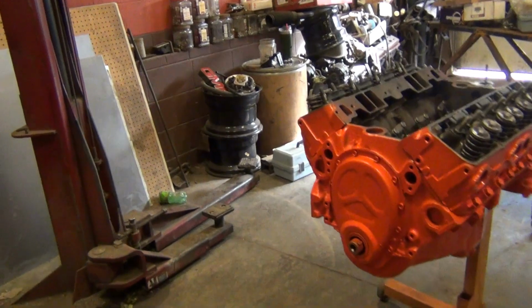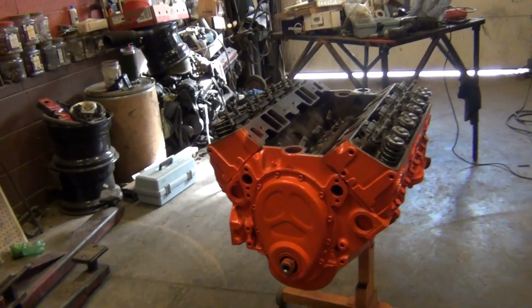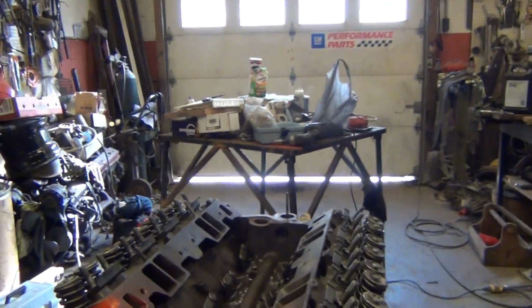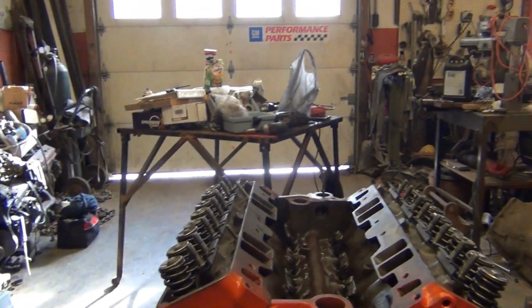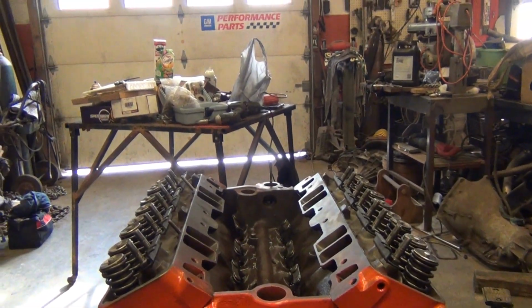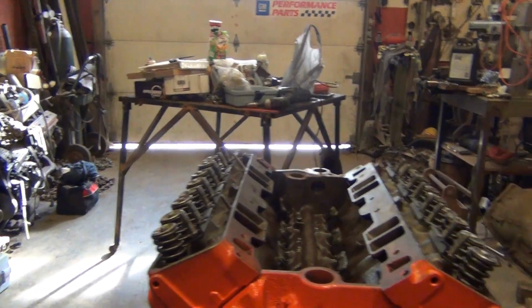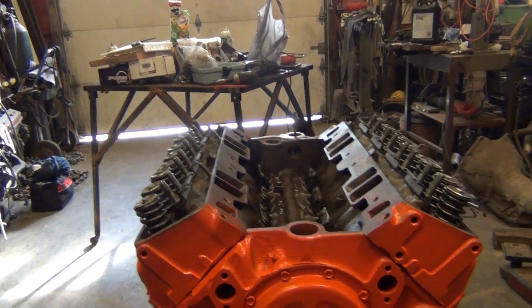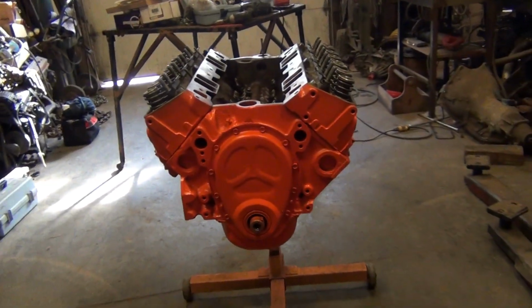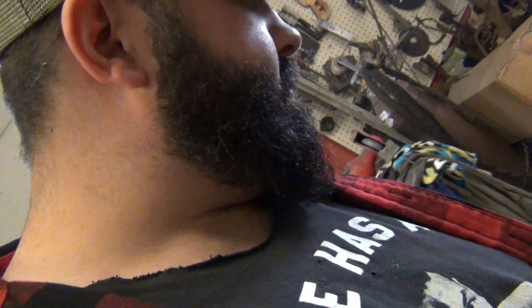And I got a stock 283 water pump. I got to put the balancer and stuff on it, but I'm gonna drop the push rods in it. I got a 89 thousandths wall thickness push rod, 7.8 stock length. So I'm gonna drop the push rods in, and then I'm gonna grab some rockers and throw them on and check everything, check the geometry, and then go from there. And just like with aluminum rockers, you got to clearance these too.